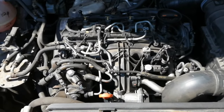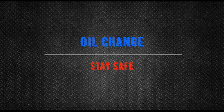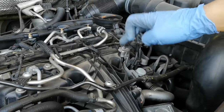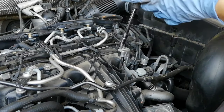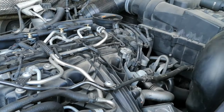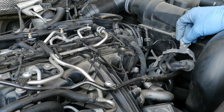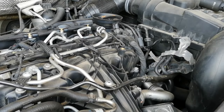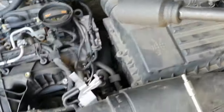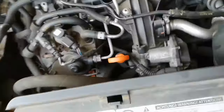Right guys, this is the part of the oil change. First you need to remove the T30 screw that holds the sensor. You should do the oil change while the engine is warm because it gets rid of more oil and quicker as well. Once you remove that, it gives you access to the oil filter housing. You'll need a 32mm socket with an extension. What I do before draining the oil is just crack the oil filter off so it's loose.